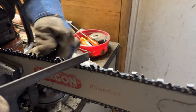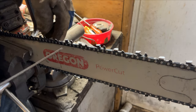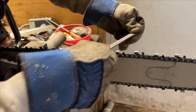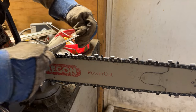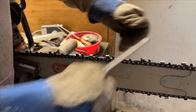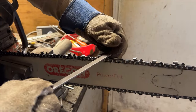As you sharpen your tooth, it gets a little shorter — you can see there's a bevel on this tooth. It gets shorter the more you sharpen it, but the raker would stay the same height. So what you do is you file a little bit off the raker and that way you'll get a better, deeper cut per tooth. You can only go one side at a time, and I go one single pass — you're trying to get everything nice and uniform so that your saw cuts good. That little tiny bit I'm taking off will greatly change the way this chain cuts.